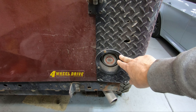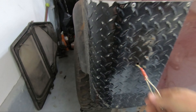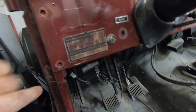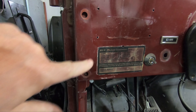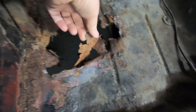We'll pull out the fuel fillers, and hopefully we won't have all those pollution control doodads we had on the other one. These are taillight wires sticking out. It shouldn't take too much work to get this tub ready to come off. The VIN number looks like it's right here on the dash — part of the original stuff. You can see the driver's side tub metal — there's just nothing left of it. Completely rotted through. It was well beyond time to fix this old girl up.